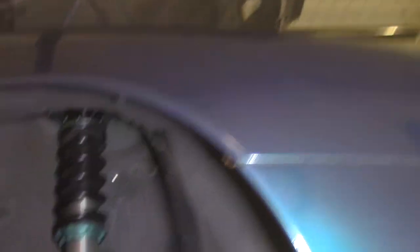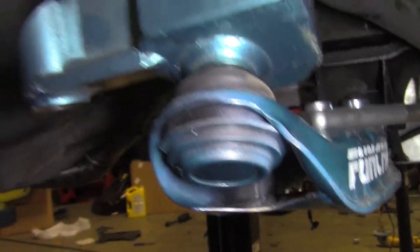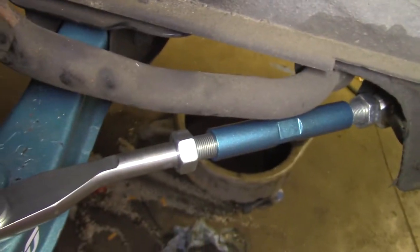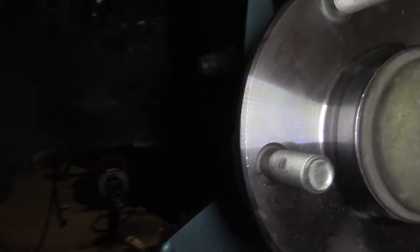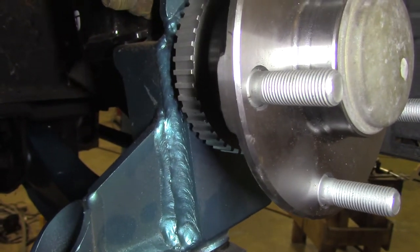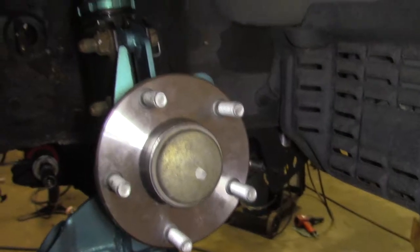Galen put most of the front suspension on the car. Let me take you through the front suspension a little bit before the brakes are on so you can actually see this stuff. What we've got here is a Function Motorsports extended lower control arm with brand new bushings and brand new ball joints on it. This is a Function Motorsports high angle tension rod — if you look at it from the top, it's got a little angle to it, which helps clear the wheel. And then we've got a set of Driftworks Geo Masters. I literally bought these from a guy who was selling 240 stuff, and this was sitting in a bucket, so I bought it. It's got brand new hubs on it for the 5-lug swap.